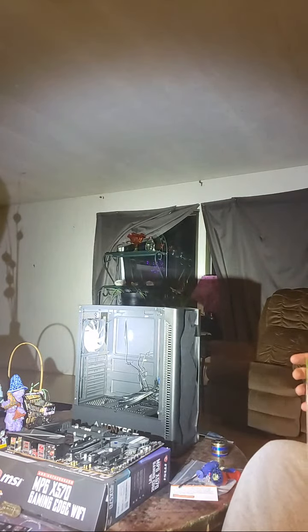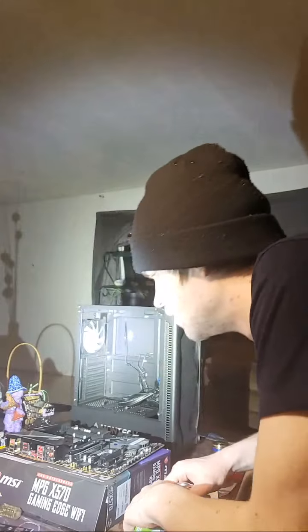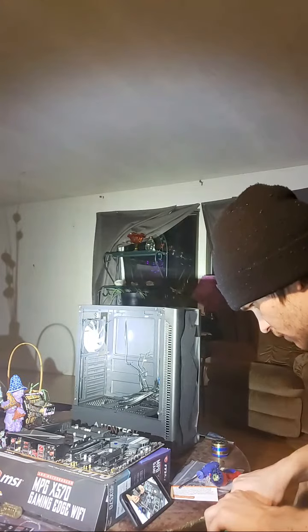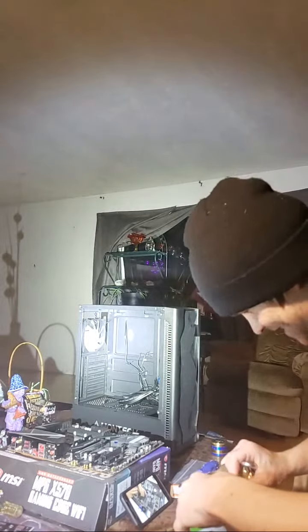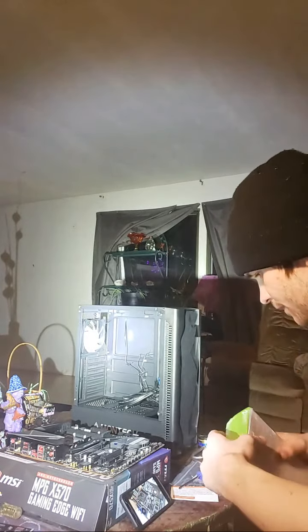And then the other stuff on here, these are just sort of like tools that I use when building a computer. The only one you absolutely need, well, let me get the CPU out of here. The one you really need is a screwdriver. You need a Phillips head screwdriver. This is a number 2 Phillips head screwdriver. Any sort of length will do, but I generally prefer a slightly longer one, just to make it a little bit easier when screwing in screws. But a magnetic tip also helps a lot. Not required, but definitely appreciated. Makes things a bit easier.